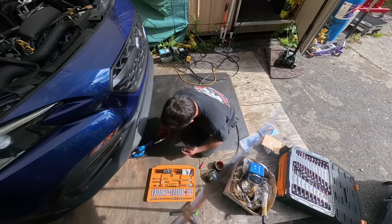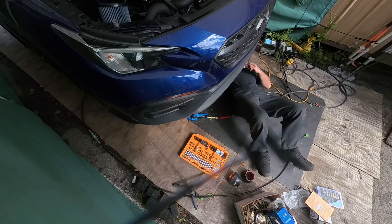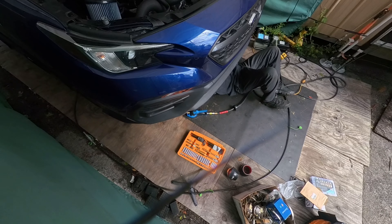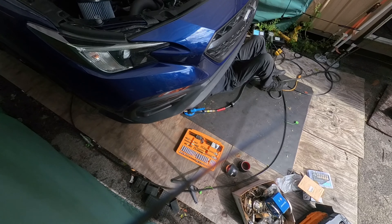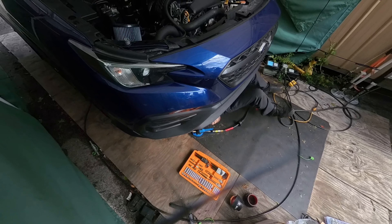The culprit is this pipe down here — there is an O-ring and that O-ring is leaking. It's not fully seated. This is why it passed the smoke test, because you can't see a pressurized air leak in a smoke test. Smoke has no pressure. They do make machines that do both, but they're difficult to find, and unfortunately our shop's machine does not.